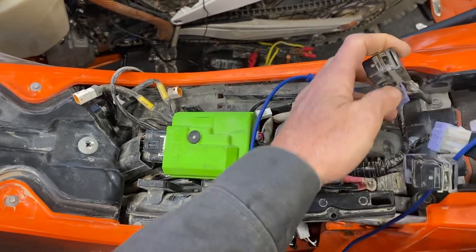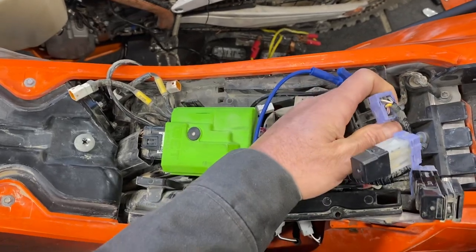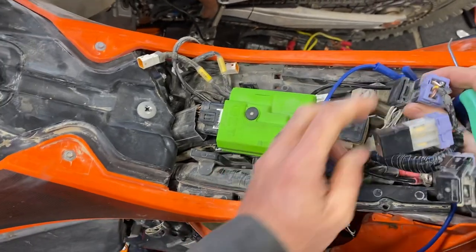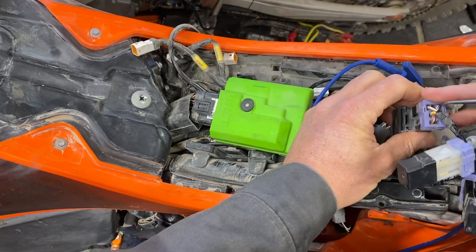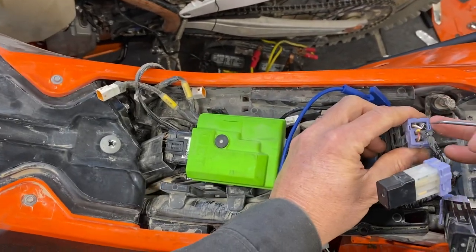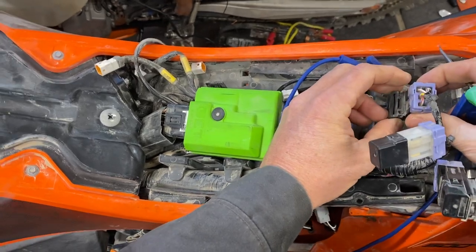On the last one, which is the fuel pump relay, if I activate that, I will get one cycle of pump run. And so if you heard that — the pump ran for one cycle. It does not repeat itself until you cycle the ECU with a run cycle. So you'll be able to activate that and it'll trip the pump that one time. If I wanted to do it again, I'd have to do a key cycle. Okay, now if I do it again — there it is. So if you wanted to do that multiple times, each time it would require you hitting the key.